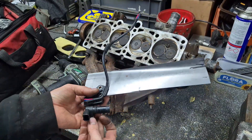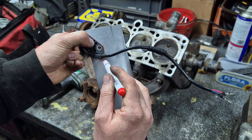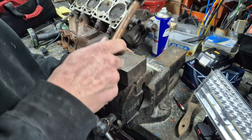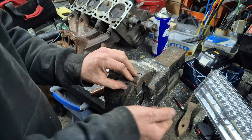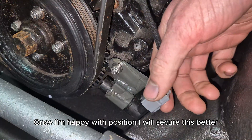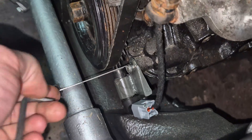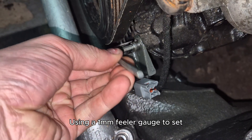When it came to wiring the crankshaft sensor, I found the MX-5 sensor I had was faulty. As my other cars all run a Jaguar Ford-style crank sensor, it made sense to maintain that commonality — it means I only have to carry one spare for all of the cars. I made a small bracket which adapted the Jaguar sensor to sit in a similar location to where the MX-5 sensor sat. Personally I don't really like the single-bolt design as it allows rotation on the sensor, which means it can be knocked out of alignment. The sensor gap is very sensitive — you can be too close as well as too far away from the trigger wheel. These Jaguar ones like to be around a millimetre away from the pickup points.